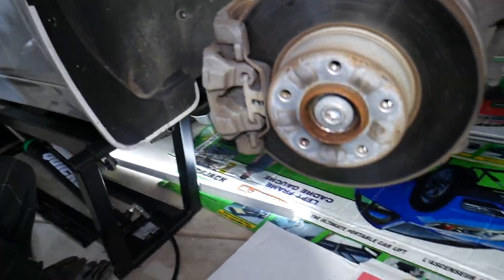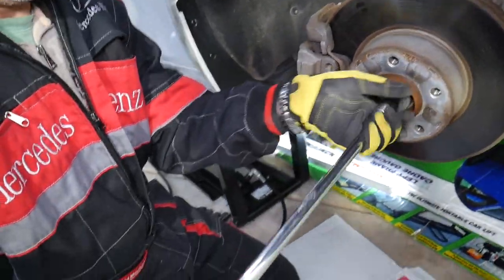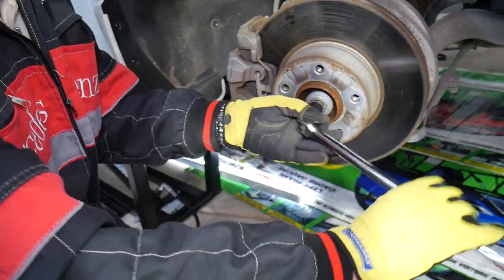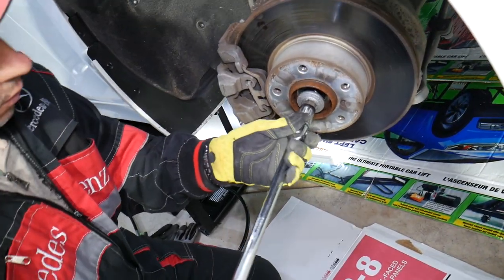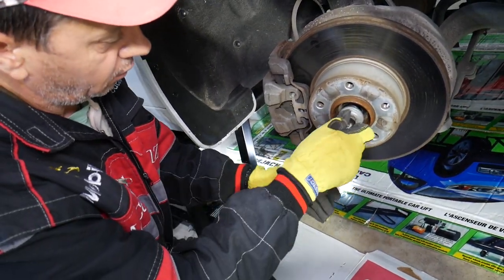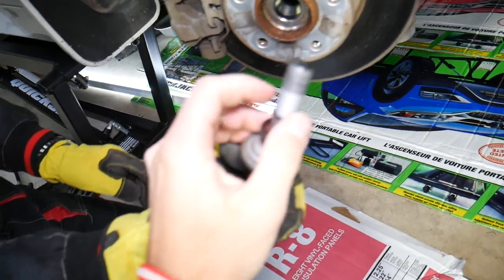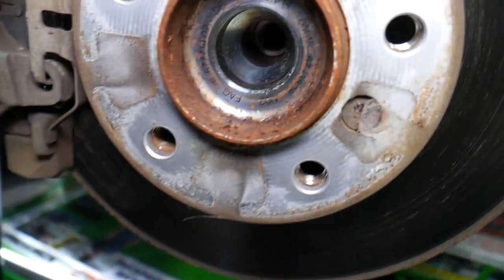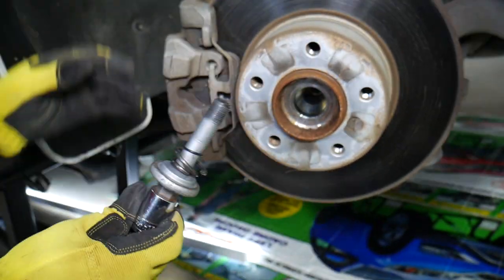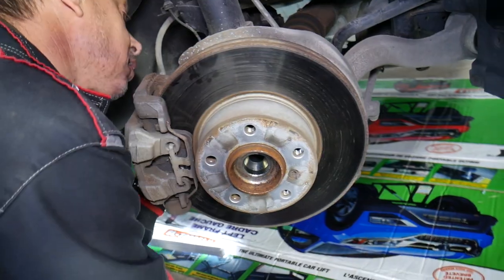Let's see how long the bolt is. Usually on most vehicles it's actually a nut, but this BMW has a spring too — like Porsche and Volkswagen, many of those use a bolt like that. You have the spring and also a little O-ring right here, and it goes on the CV axle just like that. So we're going to turn the steering wheel and get a big screwdriver.